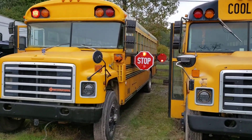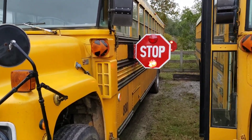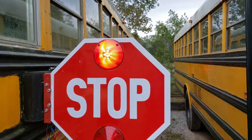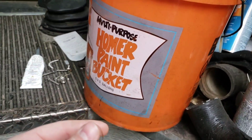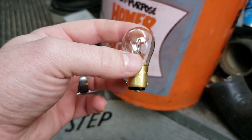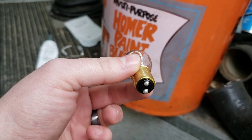It's the front stop sign. Anything look strange about the top light? If you guessed LEDs, you're correct. Now, I found these buses use an 1156 DC bulb for their stop arms. So it's an 1156 — you notice the pins are not offset like an 1157, which is the dual filament brake and tail light bulb. But it has two pins on the bottom, just like an 1157.